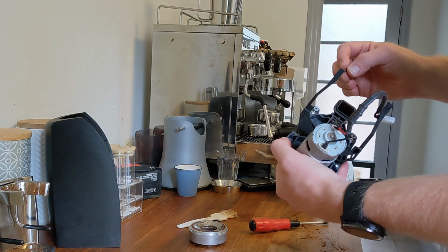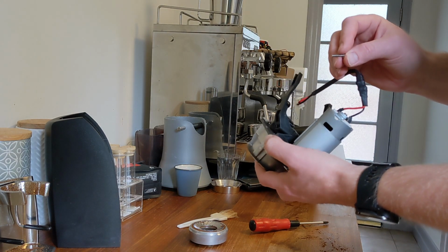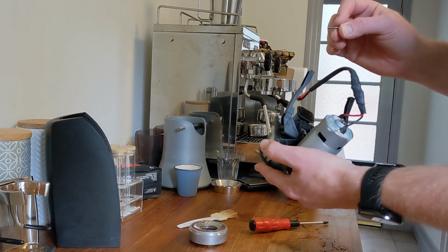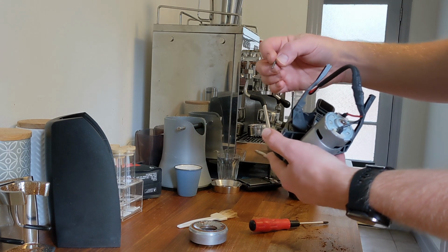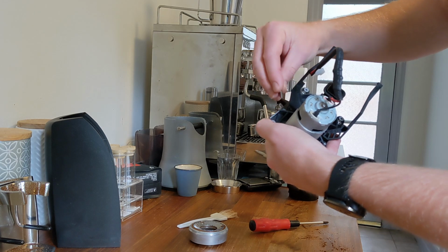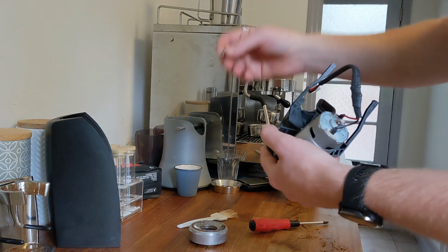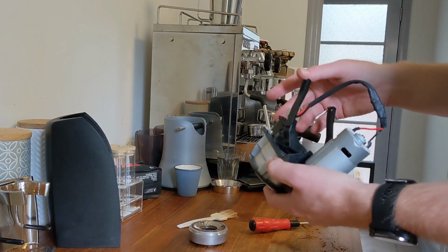The first time I tried this, after I'd got it initially aligned, within only a couple of days of using it, during a grind the machine went clunk and the quality went down. And I found afterwards that this rounded button head had slipped back into the hole a little bit on all four of them, and it had just fallen out of alignment.